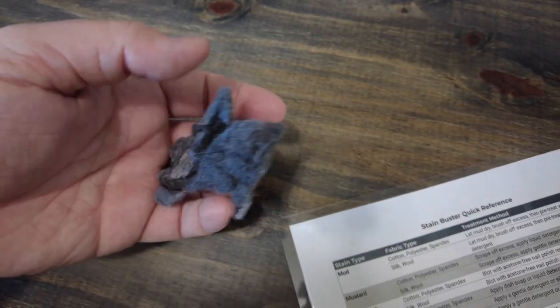Now let's switch gears and talk about the dryer. The biggest issue you have to focus on with the dryer is lint buildup — it's the enemy of every laundry room for two reasons. First, lint buildup can make your dryer more inefficient, causing it to use more energy than it needs to in order to dry your clothes. That can lead to wet clothes too, if your dryer is older and doesn't have a moisture sensor, or if your moisture sensor is bad, because the amount of time needed to fully dry your clothes will have to increase. If you don't adjust for that, you can have wet clothes sitting in your dryer — and wet clothes sitting in a dryer can cause, you guessed it, funky odors.